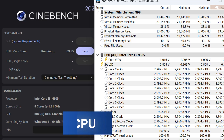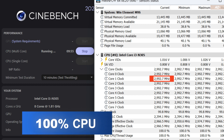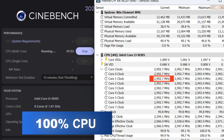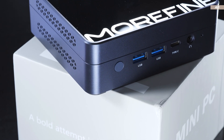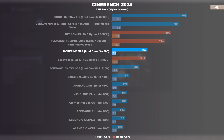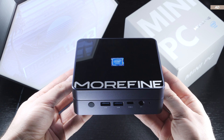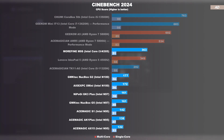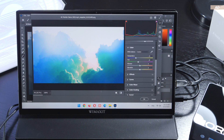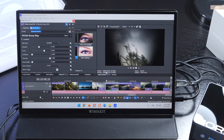If we put the i3-N305 CPU at full load, we can initially read out a clock speed of just under 3GHz on all 8 cores. Even after 2 minutes of full load, the clock speed remains unchanged, which I consider to be very good, as this is an indication that temperatures are under control. The performance test with Cinebench 2024 ranks the i3-N305 noticeably above low-end classics such as N97 and N100 models. We are still talking about anything but phenomenal performance, but at least there's a lot you can do with it, especially considering the price point. Single-core performance, on the other hand, is suspiciously similar to related Alder Lake CPU models. Nonetheless, with an N305 and its 8 cores, you can actually do some light image and video editing, maybe even rendering, if you're not pushing it too far.